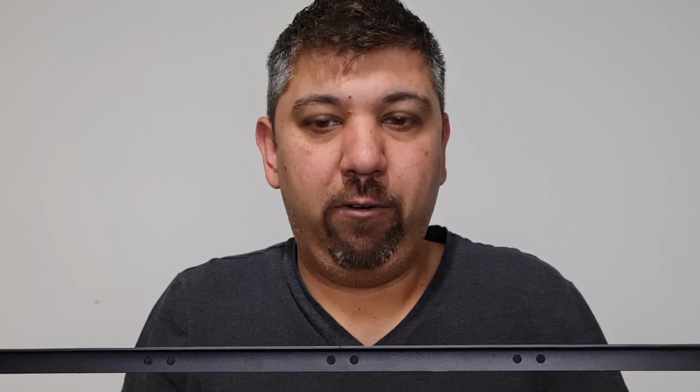What I wouldn't do is, if you're using 800 watts, buy an 800 watt power supply, because you just have no headroom, because it does fluctuate a lot. It will go up and down. But look, the other thing is that you could use whatever power supply you have, and you can look to use MSI Afterburner to undervolt and overclock your GPUs to use less watts. So that's an option for you as well if you haven't got the funds to go out and buy another power supply.